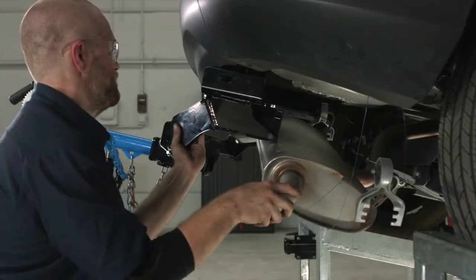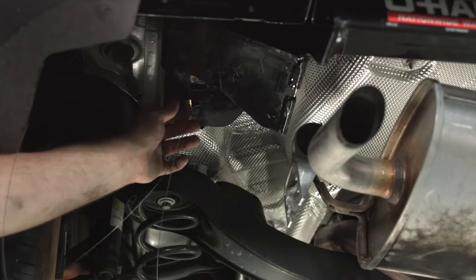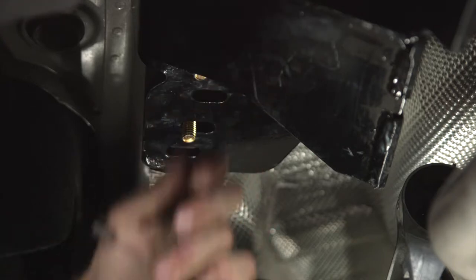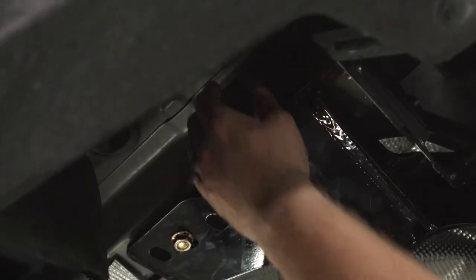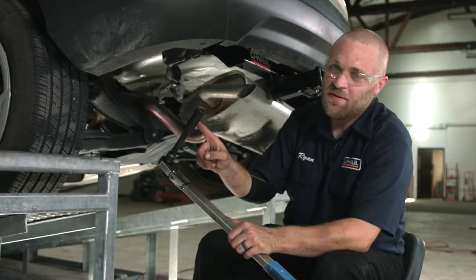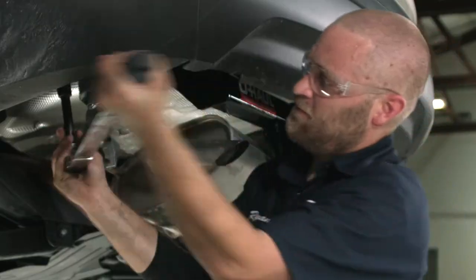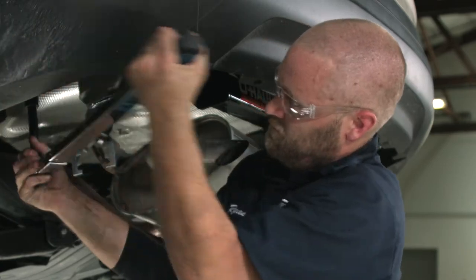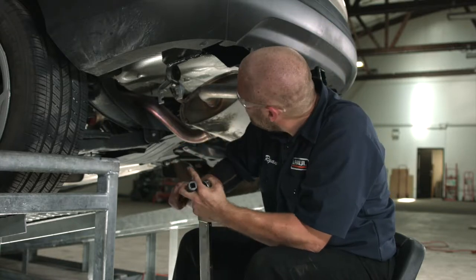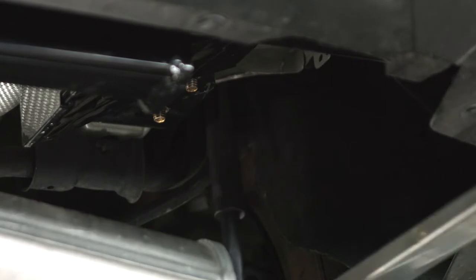Back on the driver's side, we pulled our fish wire through our attachment points, removed them, and attached our flange nuts. We'll do the same thing on the passenger side. Then we're going to use a 17 millimeter socket with an extension and torque wrench to torque the carriage bolts down to specification. We'll remove the extension to get into that side bolt, then repeat the process on the passenger side.